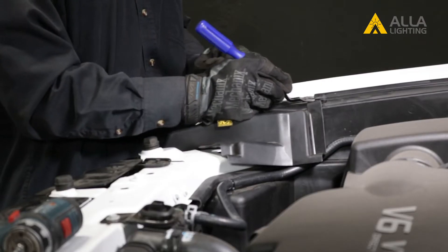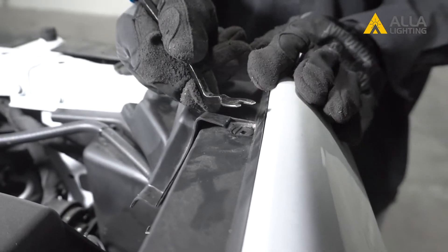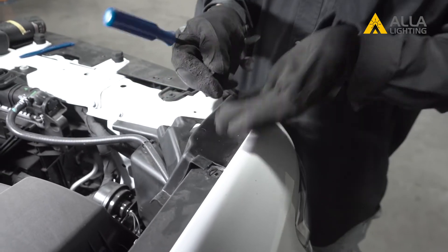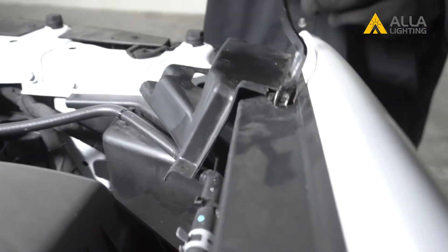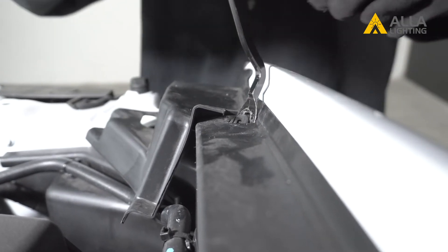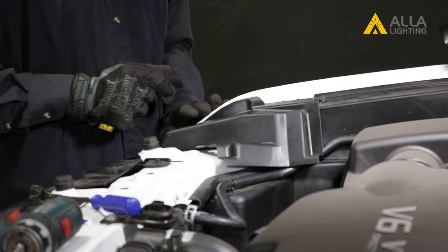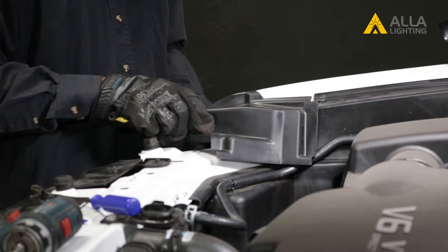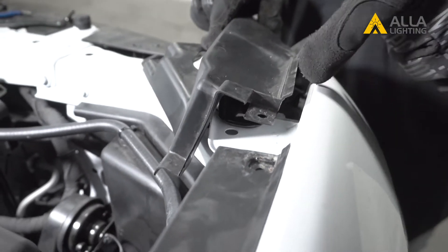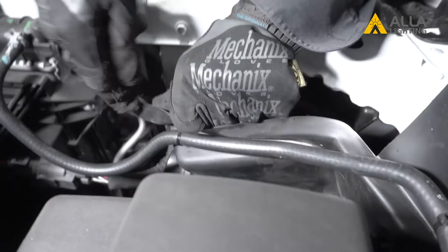Pull the middle, and then the base will come out. You can then slide the cover towards the front of the car to free it. You can see here where the clip held together both pieces. Now you can peel back the lower cover to easily access the bulbs.